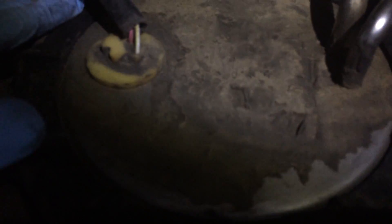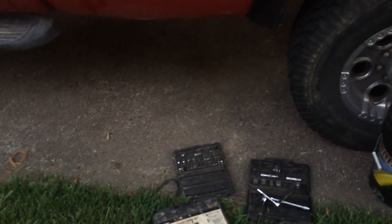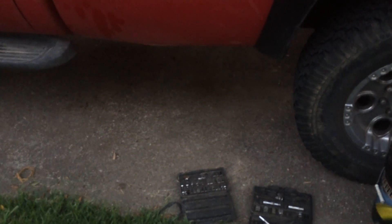I never had to disconnect the electrical connector, so hopefully I didn't damage any of that. Now rotating the tank back up into position, hooking the straps back up, and putting the skid plate back on. Getting everything slapped back together was not easy — those tank straps have a little bit of spring tension so that when they're tight they keep the tank from wiggling. Probably would have been easier up on a hoist with someone to help. Getting the straps lined up to get the tank level and then bolted up was a real challenge.